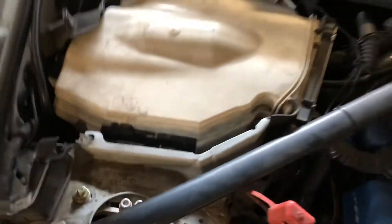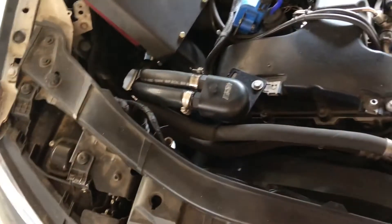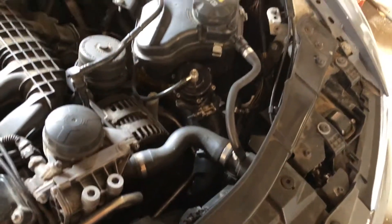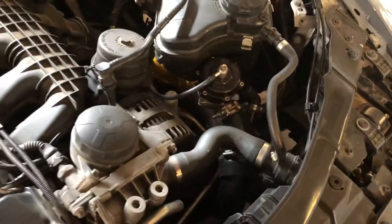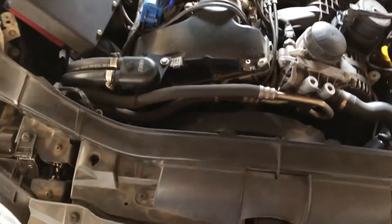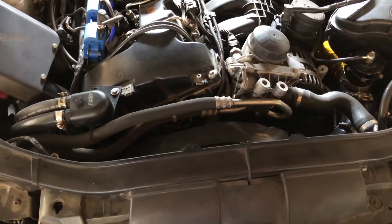My C6 box is inside the DME location. I did a relocation for the cooling reservoir, power steering reservoir, and relocated my catch can to a new location. My blow-off valve got an extended line since everything got pushed out one to two inches, and everything is heat wrapped around locations where things get hot.